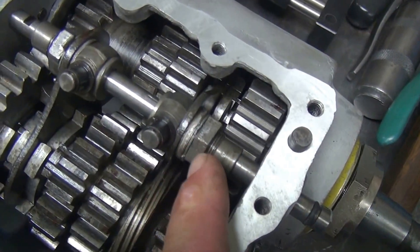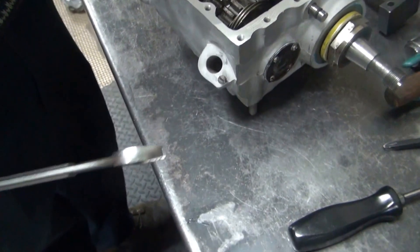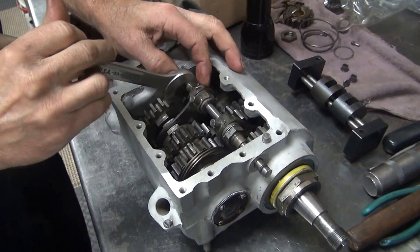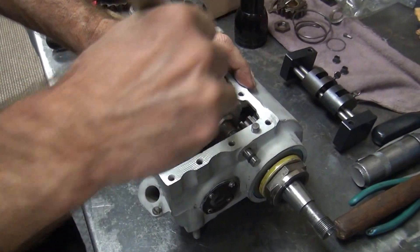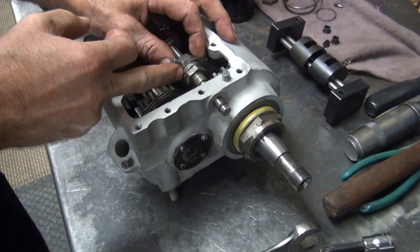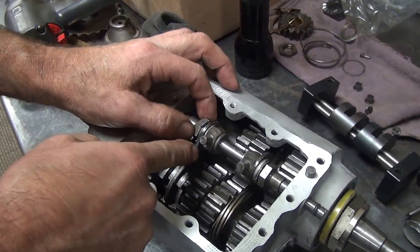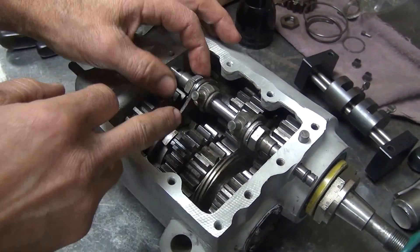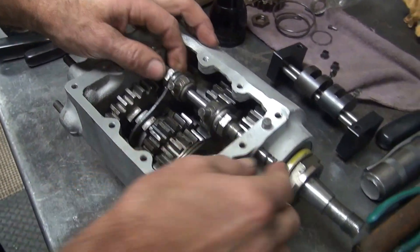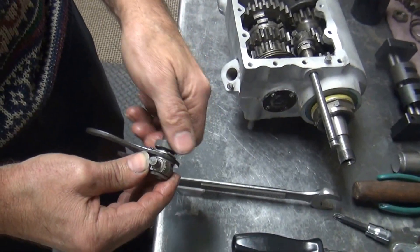Look at the size of that washer there - something's wrong. Let's take the bushings off and get these loosened up. So that one's got to go that direction. See this big fat washer here? We're going to put that on the other side of the fork, and that's where we're going to start with on that one. This one over here - see the fat washers in between the two, which is okay - but we need to take some of these washers from over here and stick them on this side of the fork to move it over a little bit. So that's the game plan.